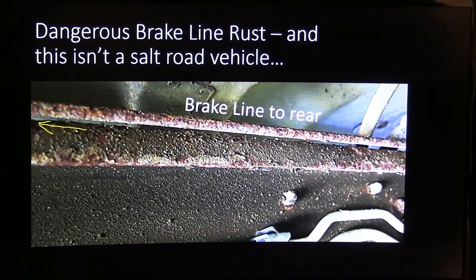you know, and Volkswagen used to run theirs in the Volkswagen Rabbits back in the 80s and late 70s, they'd run the brake lines under the carpet. And you leave the window down a time or two. If the windshield starts leaking, the carpet stays wet all the time, the brake lines start to rust. And I've actually had a brake line fail on one of those.